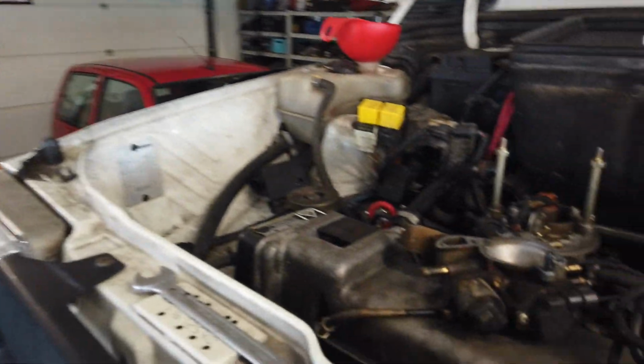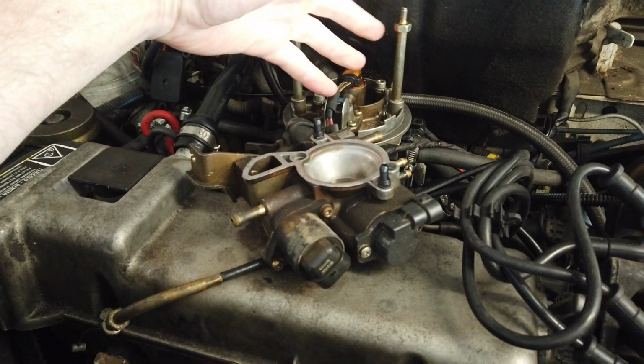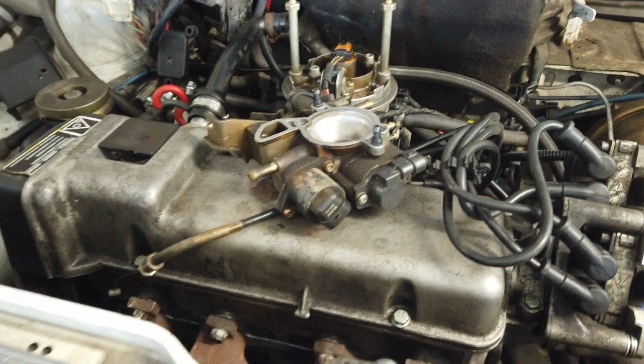And actually, when it runs, I can see the injector just randomly squirting fuel into the engine, and I was a bit puzzled at first, but I quickly realized that of course the fuel system has been altered on this car, because the turbo kit had fitted a fuel rail with 4 injectors, but the original is a monopoint, and there's no pressure regulator on the original setup, so something must have been done.